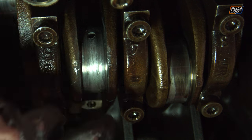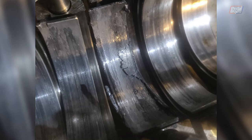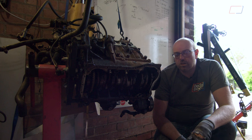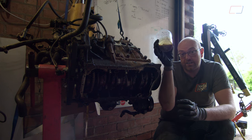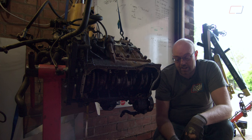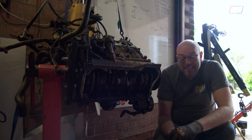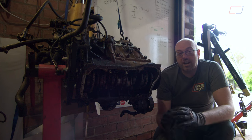And as expected, that looks pretty horrific. Those bearings are definitely toast, as is the crank, so we're going to have to pull an awful lot more out of this engine yet. This little cup of oil has a full layer of bearing material all the way across the bottom. Lots of it has been mangled through the sides of the big ends, and the bearings have just mashed their way out. So it'll be new bearings, a new crank, and possibly new rods.